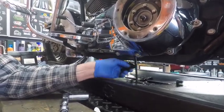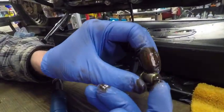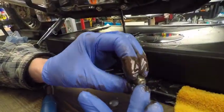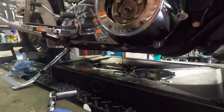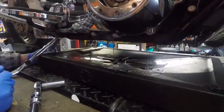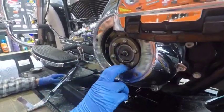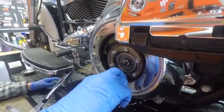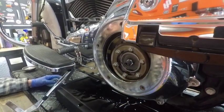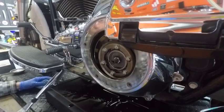The primary oil and you can see that debris on there. That's normal debris - that's just everything from clutch debris to possibly what might come off other surface areas in there. How much oil goes into the primary? A primary is pretty well a liter. You'll see when you put a liter in, it'll come up right to the edge of the clutch hub, and that's where the level should be. Pretty well a liter for these primaries.